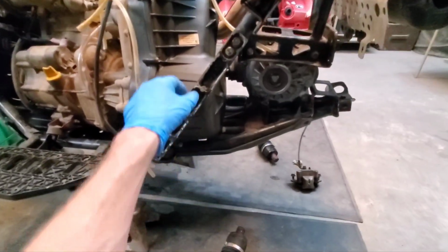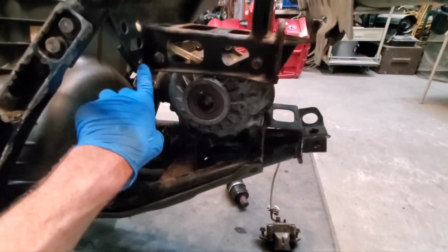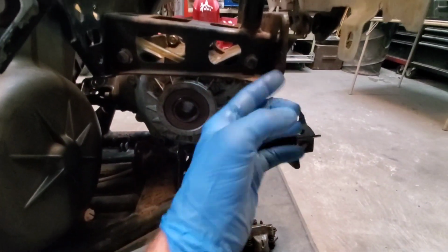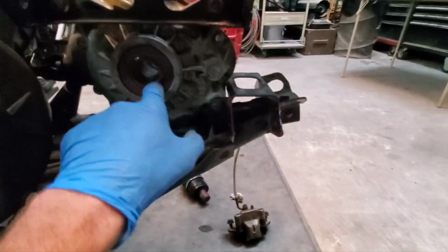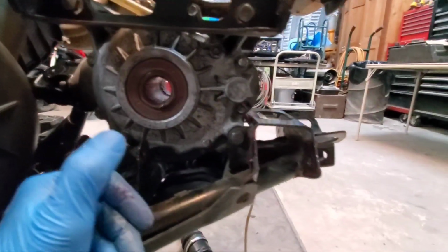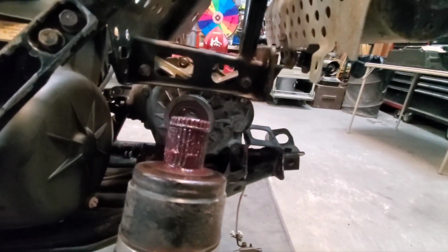And like that, the cover's installed. Good to go. Went ahead and put the crossbar back on. Took the liberty of cleaning up where the A-arms ride on the frame and greased them up so they're all lubed up, ready to go. The rear diff here is all slimed up as well, good to go. That beautiful Highlifter 1000 new diff is ready for insertion of some axles.